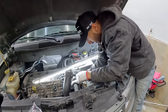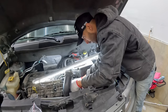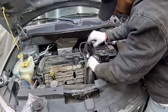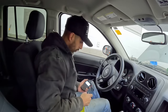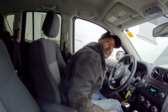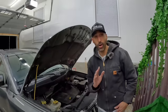The hardest part is just trying to line up that little slit inside the intake with the sensor. You want to make sure you line that up perfectly so it goes right through the slot. We got our code reader on, turn the ignition on, and clear these codes. Now that our codes are clear, let's start the car and hopefully everything resets. No check engine light — now we just got to ride this thing out and see if that does the trick.